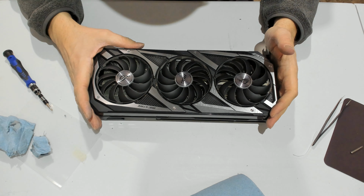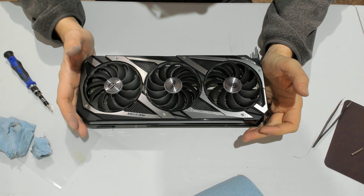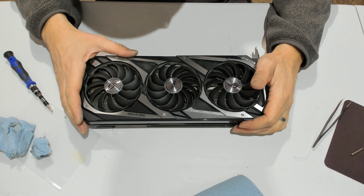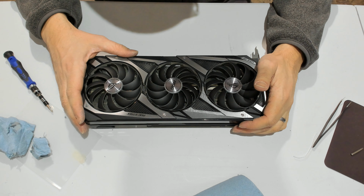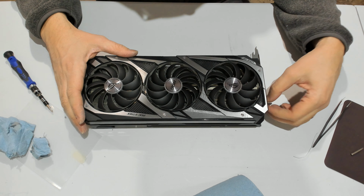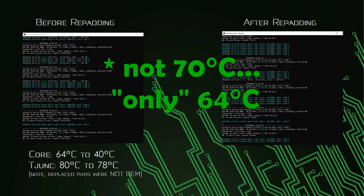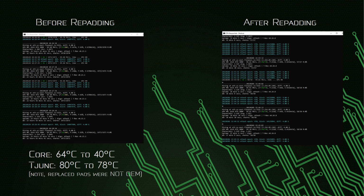RTX 3080 ASUS STRIX. We opened it, we cleaned it up, we removed the pad, we looked at the back plate. It's put back together. I'll put it on the test rig, get the temperatures, and include that in the comments. So initially, I think the core temperatures were close to 70 degrees with the hotspot over 80, and the memory temperatures were 80 degrees. So I'll try the comparison once I've tested with those new pads. That's it. Thanks for watching.